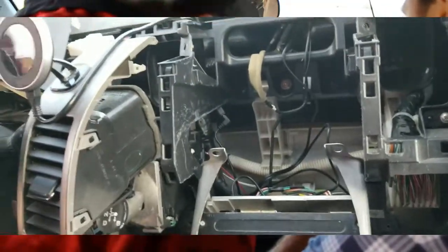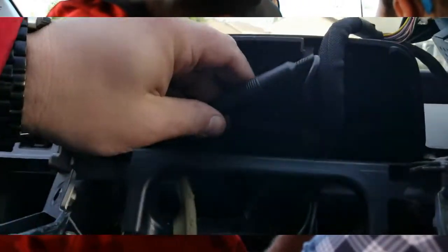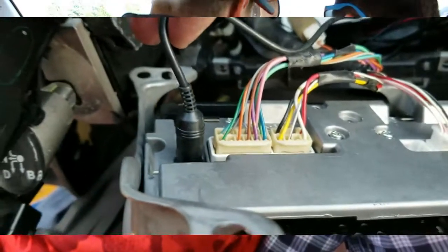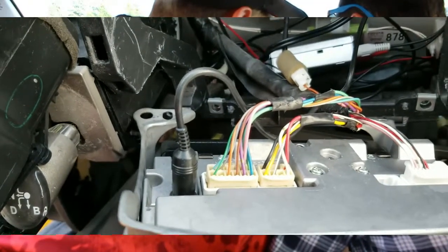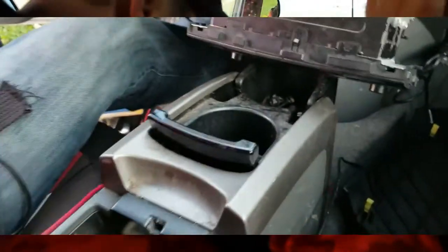So, with the button installed, the next thing is you got to install a splitter. You plug your original antenna into the antenna part there, and then into the radio back here, if you can see. And after that, you're all set. Once she has power, you can turn it on and receive your 3.5, which we have installed down here through a hole drilled, so we can plug in like the original Priuses have. And that's how that works.